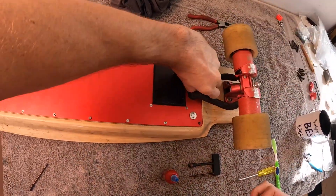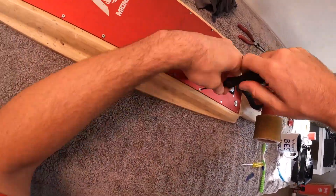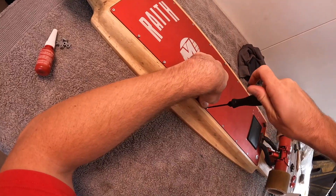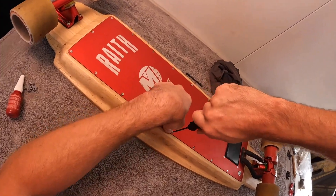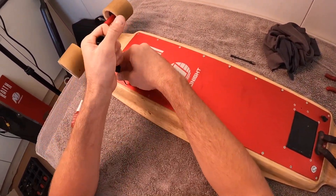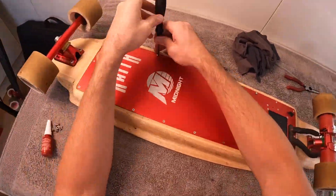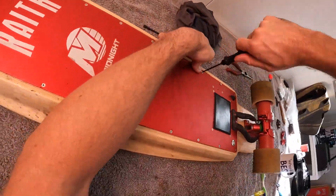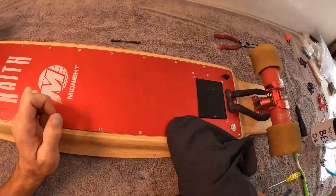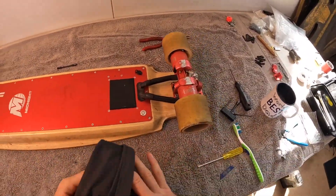Pull this one out, loctite the last two and then tighten all these up. Don't over tighten these because you will strip the hex head on the screws and then you'll need to use a drill bit to remove the screw next time. If you're going to remove one of these because it's stripped, use the biggest drill bit that you can — use a reverse drill bit, so it will bite into the top of the screw in reverse and undo the screw. Spin the wheel, check that the board switch is on and there you go. Clean up the excess thread locker with a rag and give the board a clean. She's good to go again.